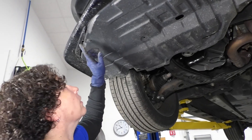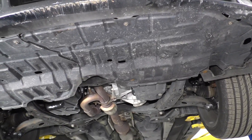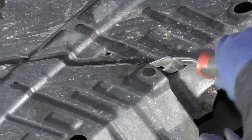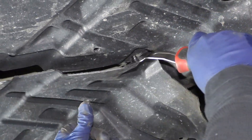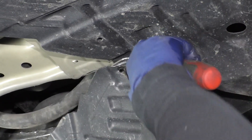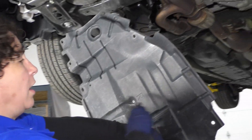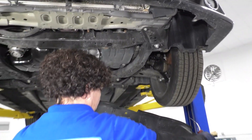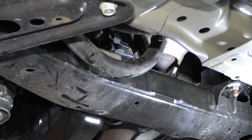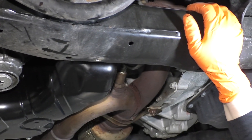There are those three bolts with that little rubber vent that just directs the airflow. You're going to take those down and then you're going to have one, two, three, four across the front, and then one body clip. Now we're going to do the body clip. There's the R for right side, passenger side, and the L for left side.